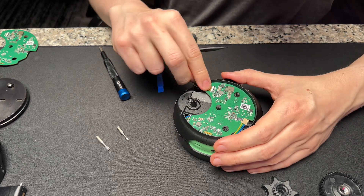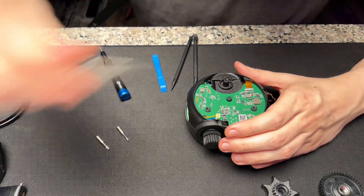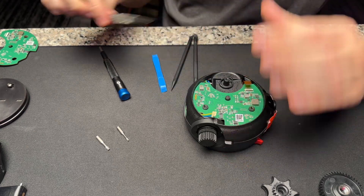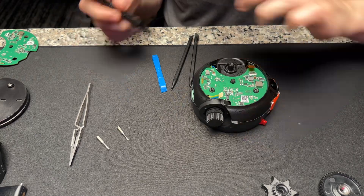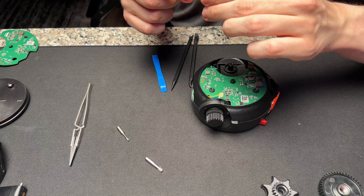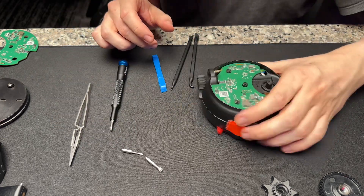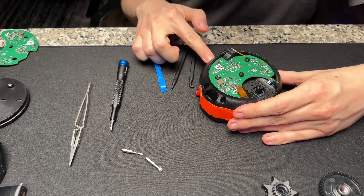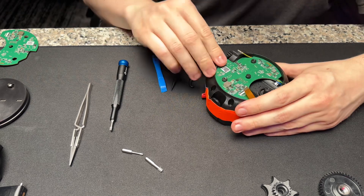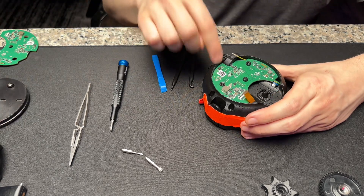Here is where the tricky part is. If you have enough stickiness in your fingers, or an iFixit kit or something, you can pull this out like that. Now you can start working towards the other piece, which is lifting off the panel. You need three different screwdrivers: a T20 Torx, a T10 Torx, and you're most likely going to need a T6 Torx — it doesn't have to be H, but it needs to be a T6. That's the part that keeps this on, but it doesn't have to come off because it's stuck to the bottom and will come off separately.